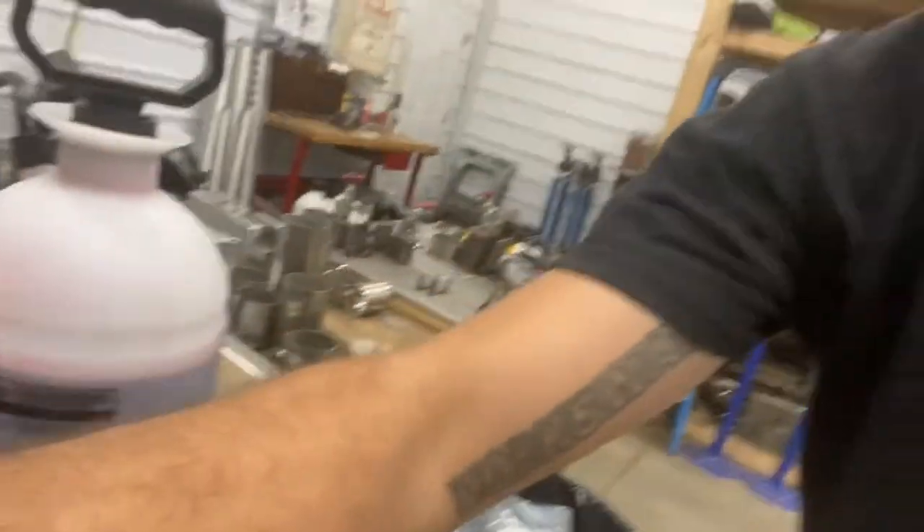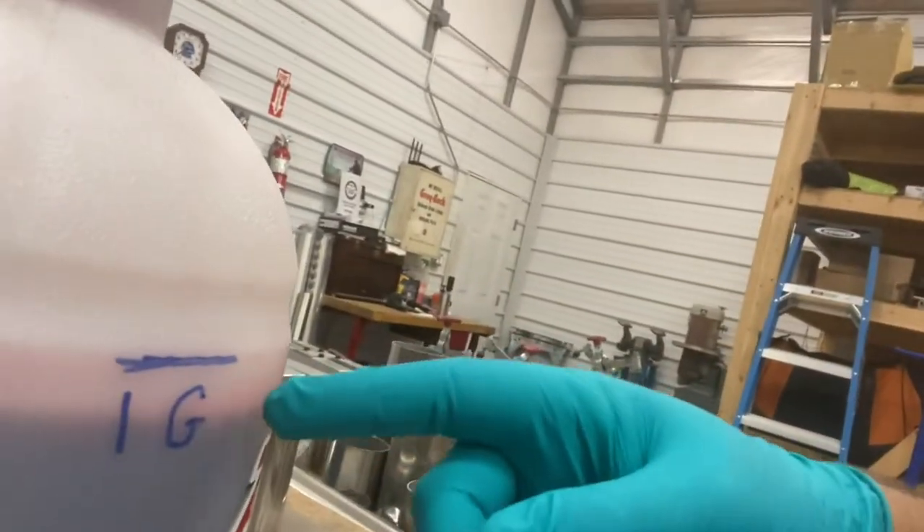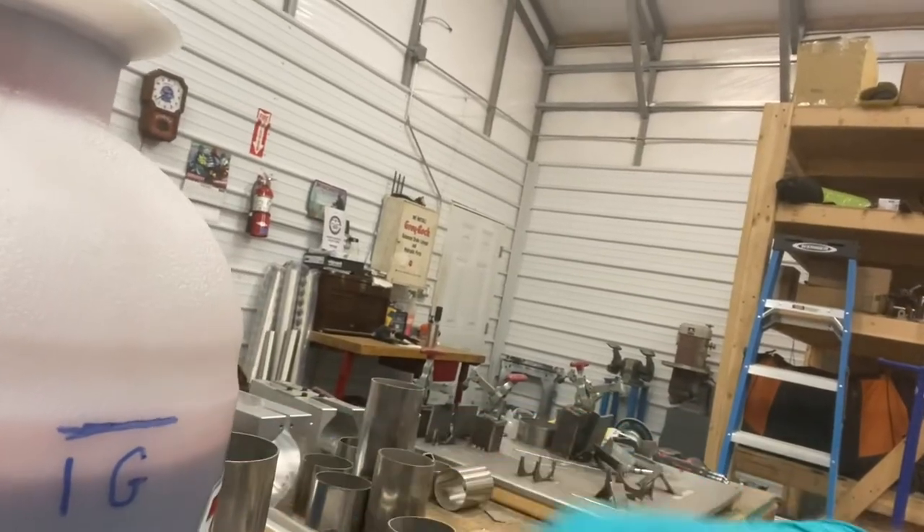Alright, that's a wrap — test drive went good. I didn't end up using as much fluid as anticipated: I had two and a half gallons and I've got about a gallon left, so two gallons would be enough in this case. Results may vary depending on how much fluid you get out of the trans cooler — I suspect if the vehicle was warm when I started I would have gotten more out, but nobody likes working on hot parts. Subscribe if you haven't, comment below if this helped you out, and I'll see you guys next time.